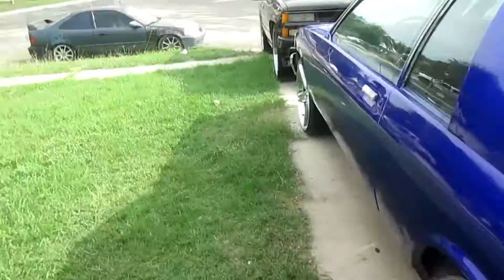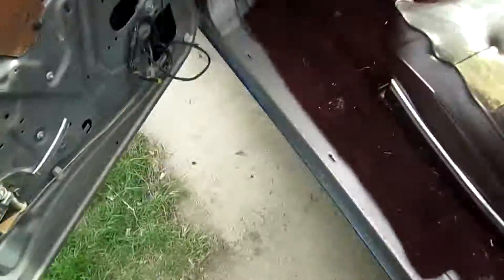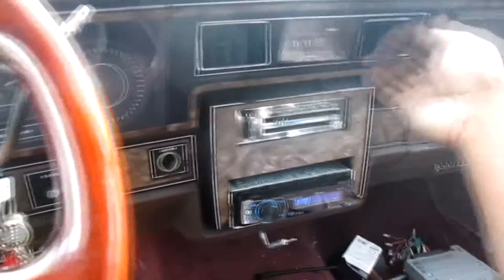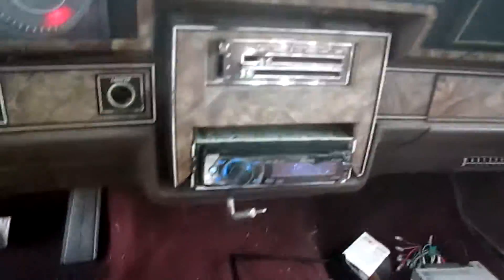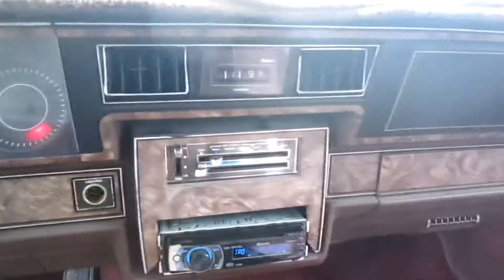Under the hood, we've been working on trying to get the air conditioning going. We were having an issue with that. Now we got a blower where it's actually blowing like it should, but it ain't coming out the vents — it's coming out down here. So we're gonna have to look into that and see why it ain't redirecting. But we definitely got it blowing; just got to get that redirected up here and we're gonna be in business.